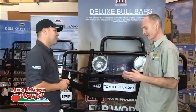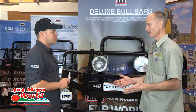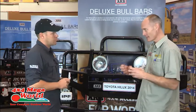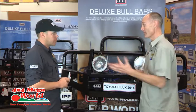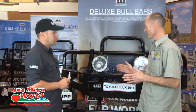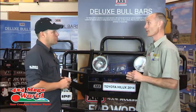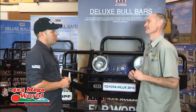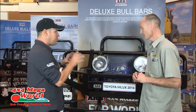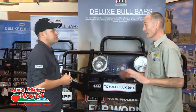Inside the vehicle is a little device that works on inertia — it's got nothing to do with outside the vehicle. What ARB engineers do is get the crush rate from the manufacturer's engineers and duplicate that crush rate into the design. So this bull bar will move at a certain speed and rate to allow the airbags to deploy at the right time. Each bull bar — this one for the Toyota Hilux — is manufactured specifically to that vehicle's specification. You can't fit it to another car.